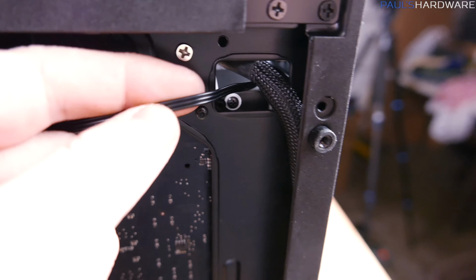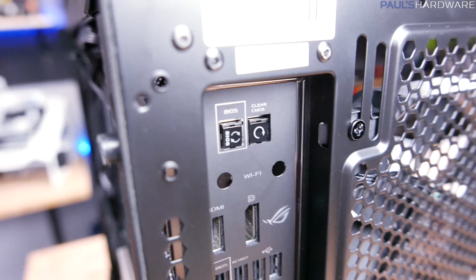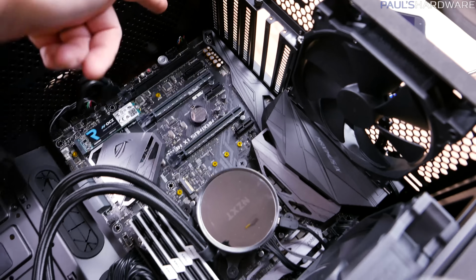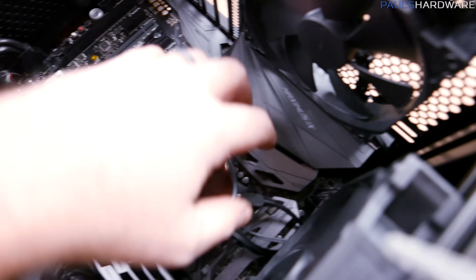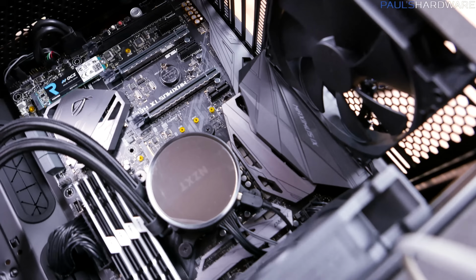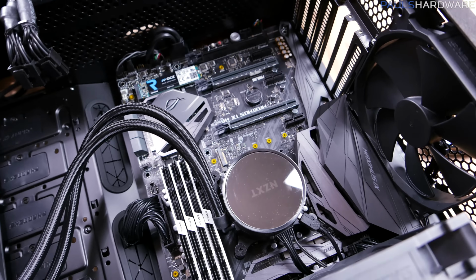Alright, so here it is, this little cable right here, and I've managed to fix it, or get it cleared out of the space it was wedged into, thank God. I didn't have to remove the motherboard, but I did have to pull the graphics card out. I removed all 9 screws, and I lifted the board up just so I could shift it away from the IO shield a little bit. Then I was able to get the screwdriver down in there, kind of pull it off to the side. And then by accessing from the rear panel, I pulled it out all the way. Okay, problem solved, moving on.